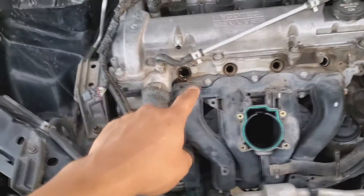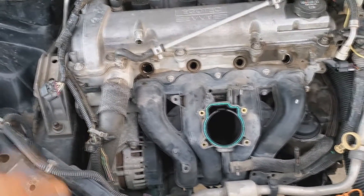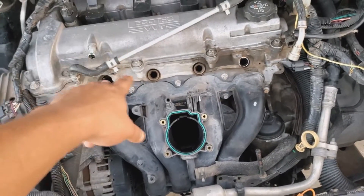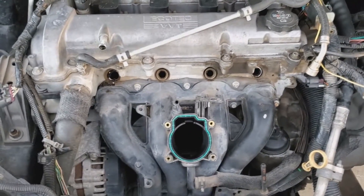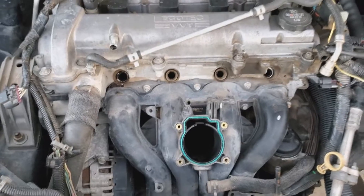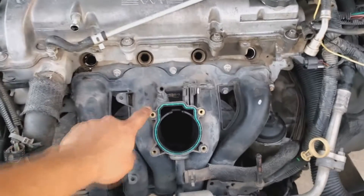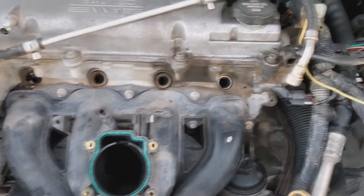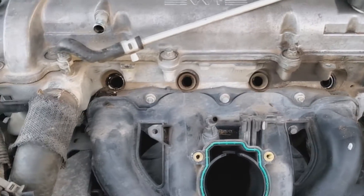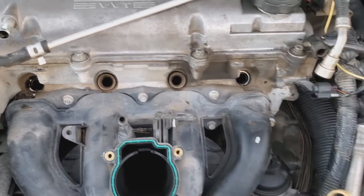For the most part that's the injectors and the intake removed. All of it has been composed of 10 millimeter bolts. The injectors had two 10 millimeter bolts along with the fuel line removed, using a 3/8 fuel adapter to remove it. The throttle body was also removed by four 10 millimeter bolts, and to remove the intake manifold you're going to need to remove seven 10 millimeter bolts holding it down.